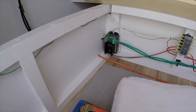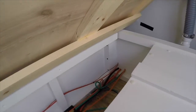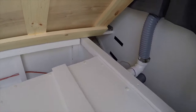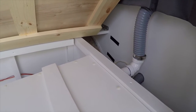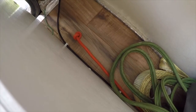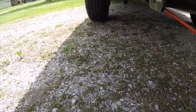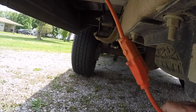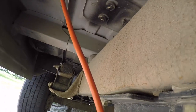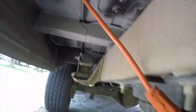There's my wire coming back from the outlet up there, across the back, through a hole, and then back up this side to the outlet over here. I've got no splices in the wire anywhere, and I'm just running that pigtail hanging out the bottom. The van isn't parked close enough to the house for a lot of extension, but I just plug my pigtail into my extension cord. I'll rig up a little hook to hang this pigtail on when I'm not using it, then silicone around that hole, let it dry for a few hours, and this job is complete.